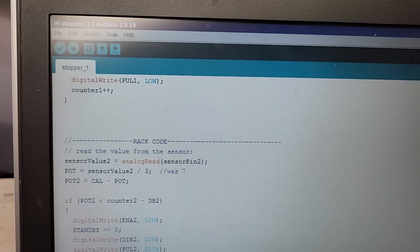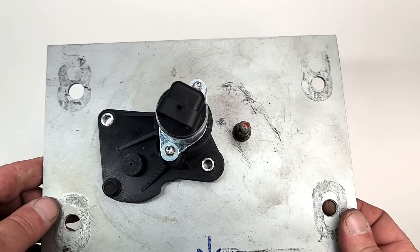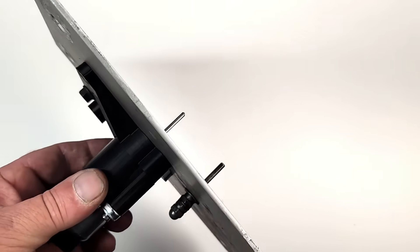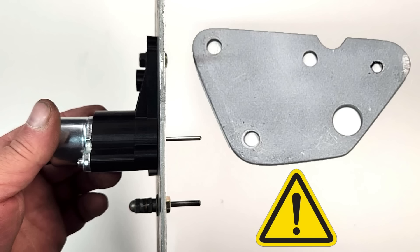A simple software hack probably doesn't help you understand what the problem is, so let's take a look at a cartoon. The rack limiter's problem is the rod is not extending far enough. This doesn't make sense because I calibrated this gizmo to be a direct replacement for the adjustment screw. Fortunately, I do have a video on how this gizmo was calibrated. Looking at the calibration rig — basically a flat sheet of aluminum holding the gizmo and the actual adjustment screw — what's important is the rack limiter was calibrated without the mounting base, and that makes a two millimeter difference, which is more than enough to cause our problem.